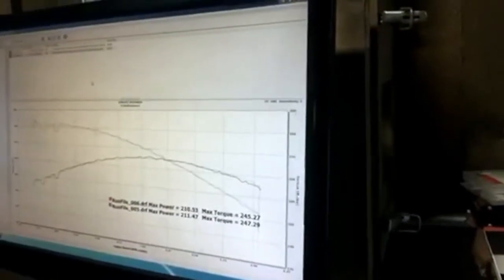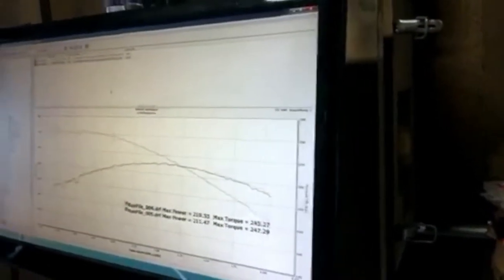Now that could be a sign of some spark detonation, but we also noticed that at the same time the alternator light was flashing on and off, so that may be something we need to look into. The spark knock might be attributed to a loss of voltage in the system. Besides that, the thing seems pretty consistent.